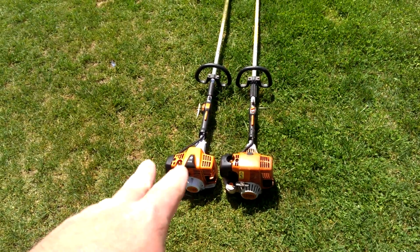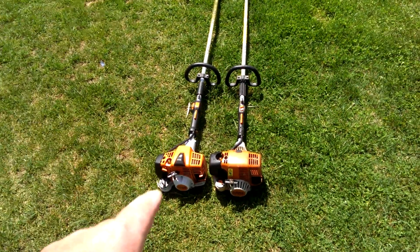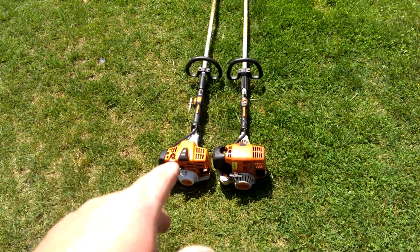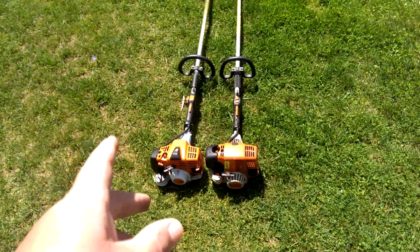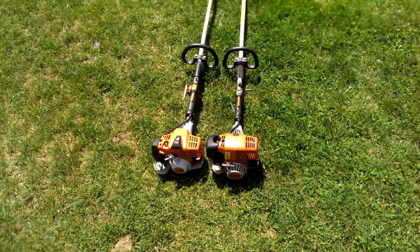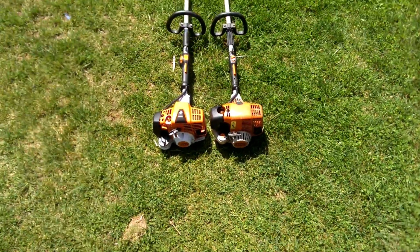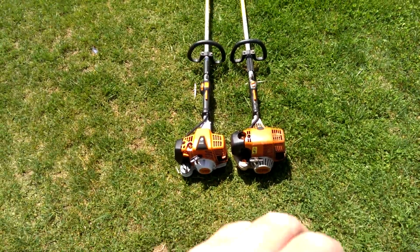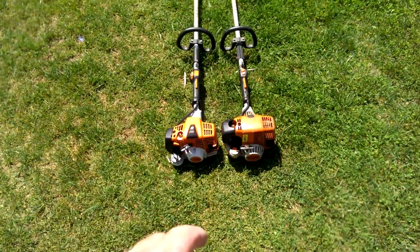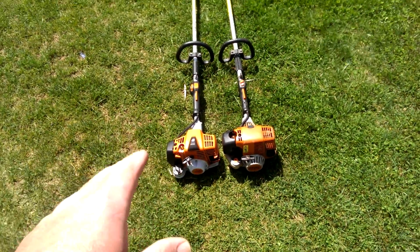It don't even have valves, it has ports. A lot of people don't know this. It has an exhaust port, intake port. The intake for the fuel is on top, and the exhaust is kind of down at the bottom. So the 2-stroke is made, it's not really a Windsor versus Cleveland talk, if y'all know what those engines are from old Fords, with a longer stroke and stuff. 2-strokes have a more pristine design.